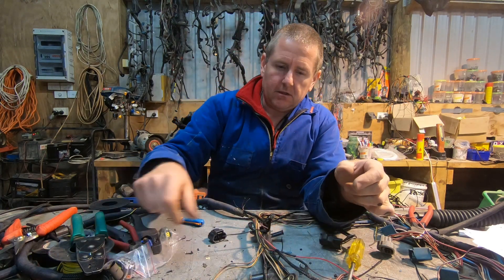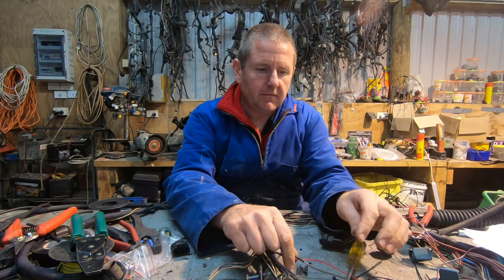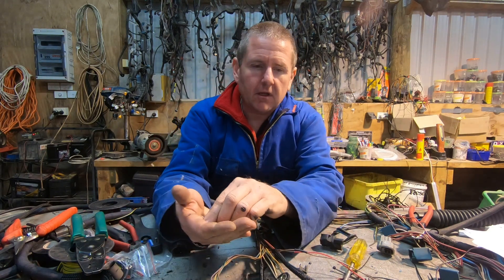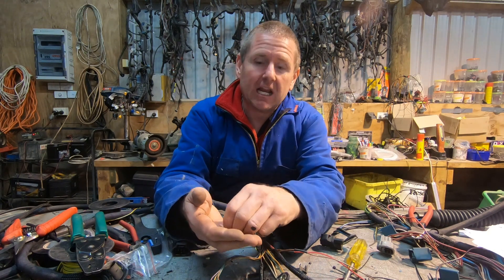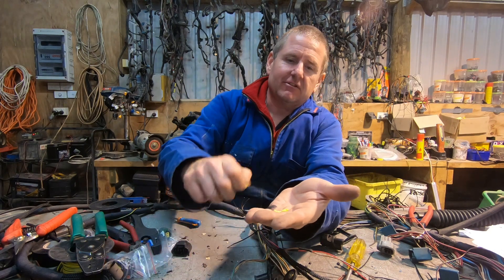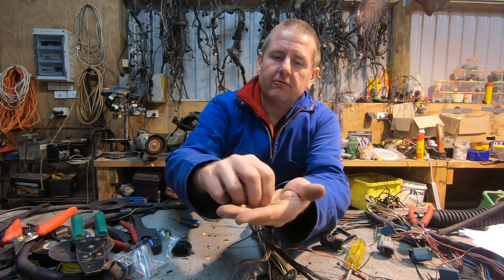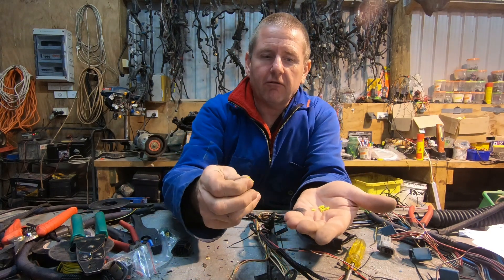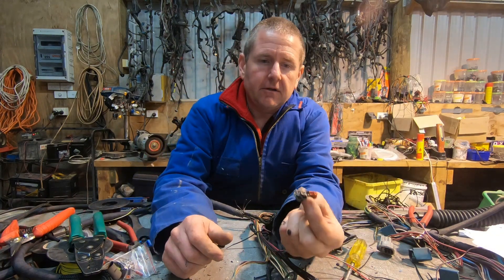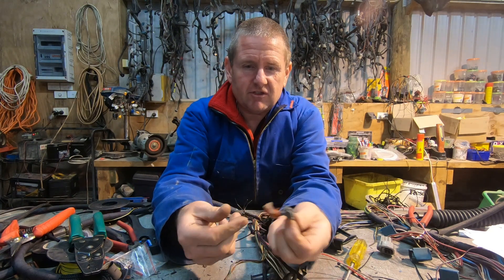I'm getting stuck into this loom — I've come down the side of the engine here, got some sleeving going on, replaced some wires because they were cracked and ugly. I just popped the TPS plug off and actually got the little cover off — the retaining clip for the wires — in one piece. And then I touched it and it just crumbled. I'm still blown away that guys are doing these looms and they don't want to take them off because the plugs might break. I take them off because the plugs do break, and then put new plugs on because I want it to be reliable for the customer. That is the remains of the idle speed control plug — it just shattered in my hands.